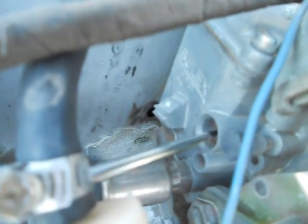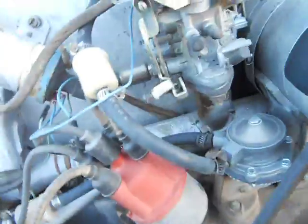Once you've hit bottom, you want to come out two and a half turns for both screws — that's one half, one, another half, two, now two and a half turns out. You want to do the same with the little screw; I'm not going to do it right now because it's already set.